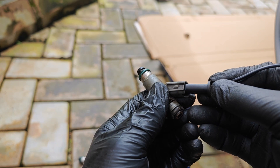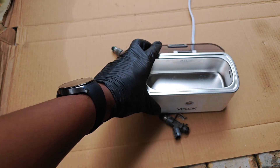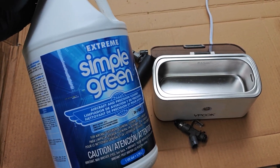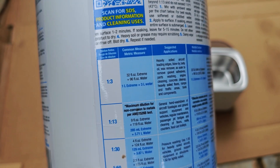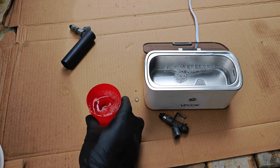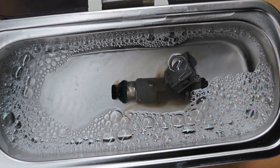This good injector clearly works, but there's no need testing the dead injector because if the solenoid isn't actuating, it's not going to spray anything at all. So let's move on to the third step: ultrasonic cleaning. I'll be using Extreme Simple Green, which I got recently and have been impressed with for its cleaning power — and it doesn't etch aluminium. We'll use the 1-to-3 dilution ratio recommended for cleaning engine parts: one part Simple Green, three parts water. The dead injector goes in and we start cleaning.